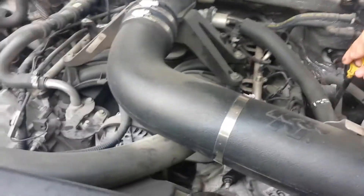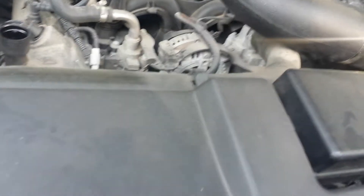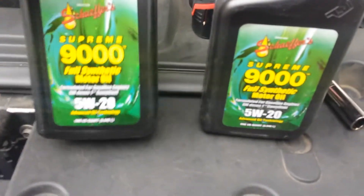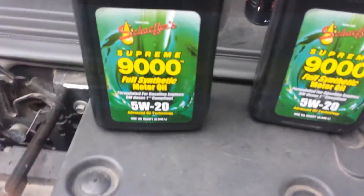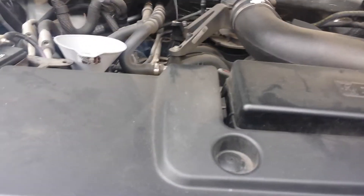Location of your filler cap. Another tip: when you're draining, just pop your oil cap up — helps get a little air on top and helps you drain. Funnel. My recommendation is Schaeffer's, and this one's full synthetic. Schaeffer's is based out of St. Louis but you've got a local rep. Use what you want, but if you want things to last, buy some good stuff. We'll fill her up and start her up.